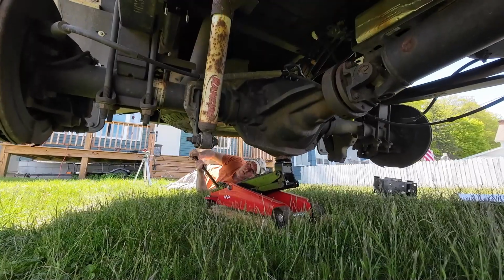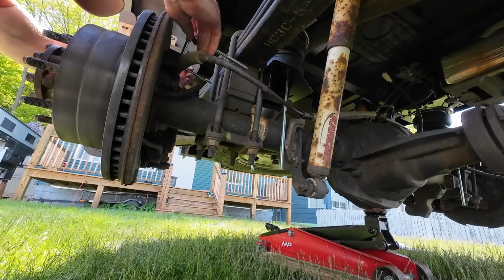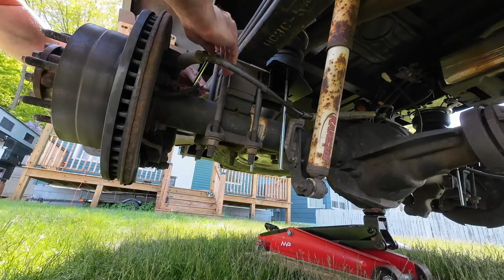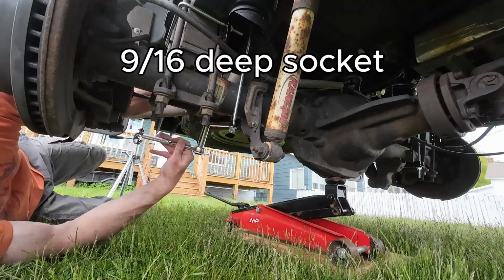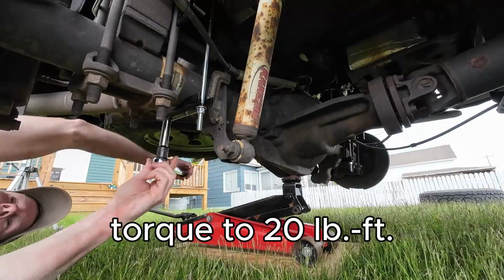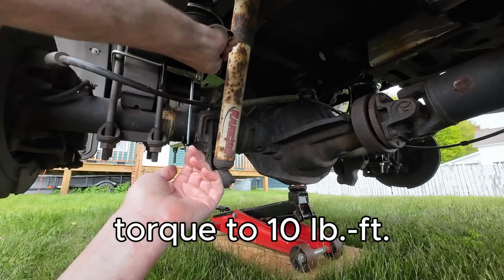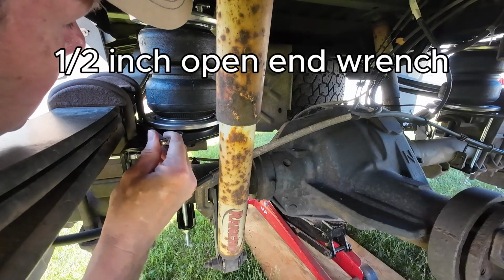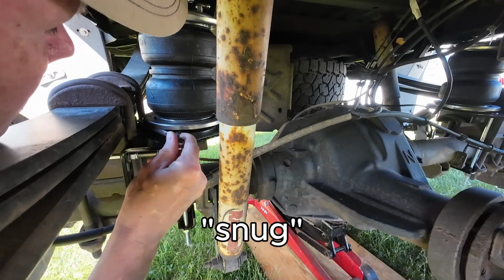Lowering the axle will significantly help with this step. A U-bolt is used to hold the lower bracket tight against the factory bump stop strike plate. The lower clamp bar is now installed onto the long carriage bolts. The U-bolts can now be tightened the rest of the way. The next step is to go back and finish tightening the hardware that holds the lower bracket cup in place.